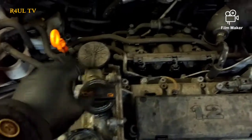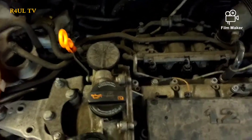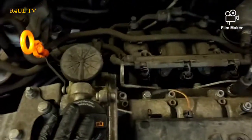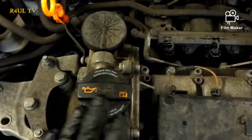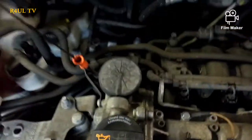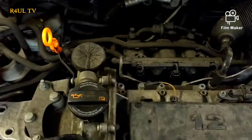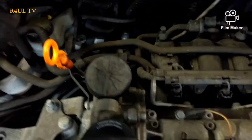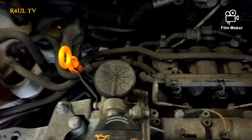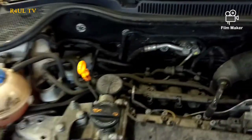After about 15-20 minutes of oil filling, I've managed to fill it up. Whoever designed the oil filler on this one — it's a really really slow filler, so don't rush; go slowly or you'll get oil everywhere. Check it on the dipstick. You can check the manual for the capacity — three litres, four litres, whatever — but just check it on the dipstick. The dotted lines on the end of the dipstick show the maximum mark; you want to be just at the top of that.